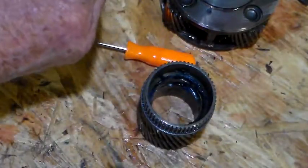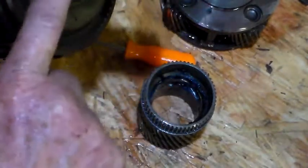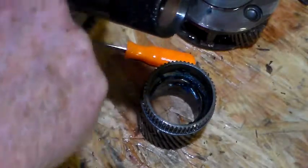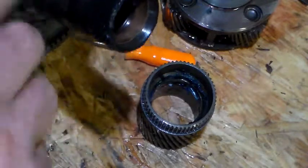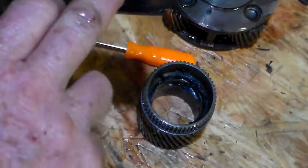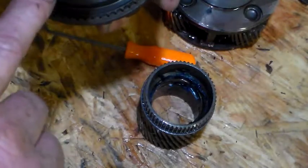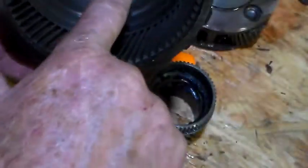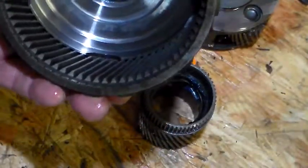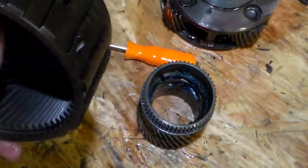The reactor — you want to feel this shaft all the way around. If you feel any high spots, low spots, or rough spots, make sure this thing's clean and you're not feeling any dirt. Check all your splines — make sure they're still there, nothing eaten up. And you want to look in here: you've got a bushing on this side and a bushing on this side. Make sure there are no deep scores in these bushings. No deep scores and all the bushings are smooth.